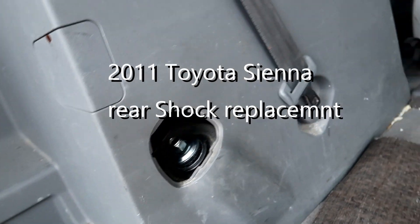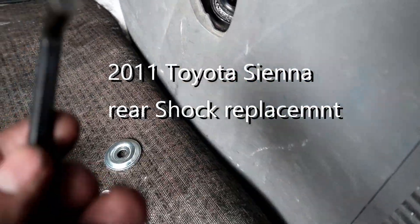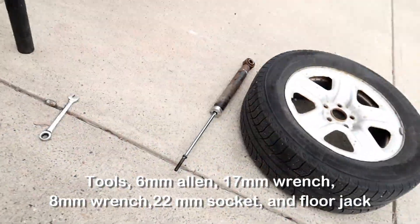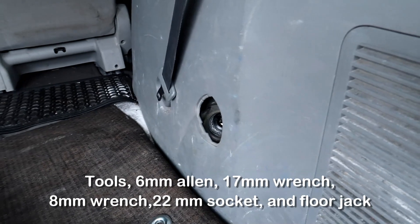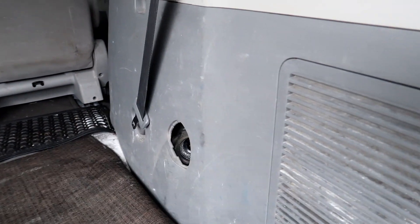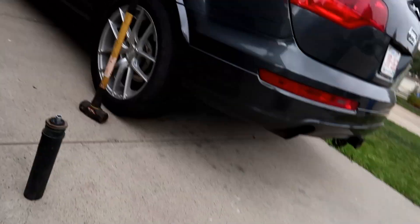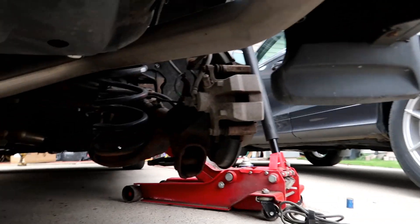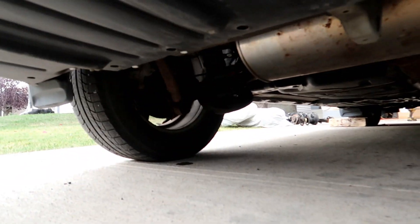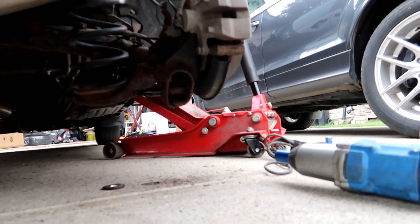In the back, you just pop up the little caps — these just come off like nothing. A six millimeter wrench fits in the top of the strut and then you unbolt it. 17 mil, it's a little bit tough to crack at the beginning but it comes undone. Underneath it is a 19 mil — that side isn't undone yet but it's soaking; it comes off pretty easy.